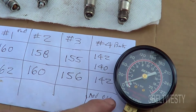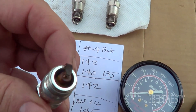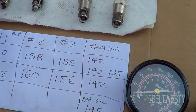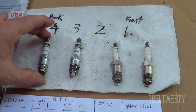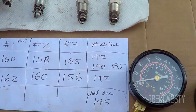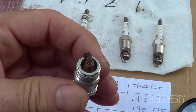The lower compression numbers in cylinder four are still fairly high overall in terms of psi. I also haven't checked whether the car has a vacuum leak toward the back — that's another thing that could be causing this issue. I may need to rig up or buy a smoke machine to check for vacuum leaks, because that can really drive you nuts to diagnose.